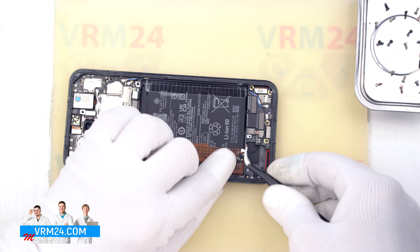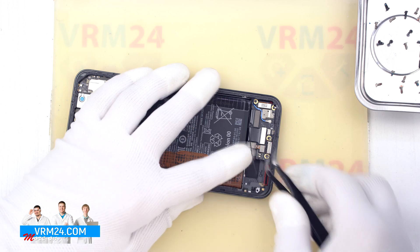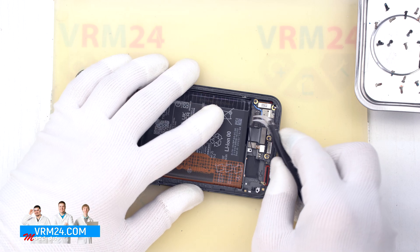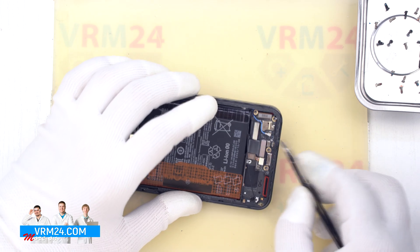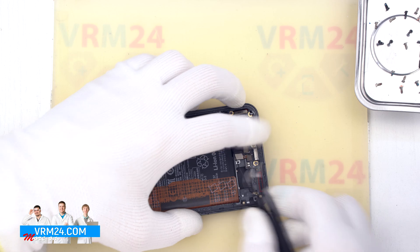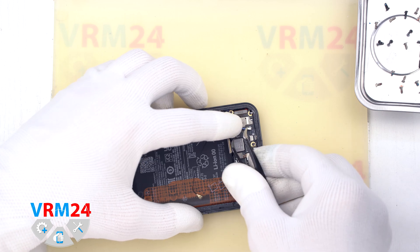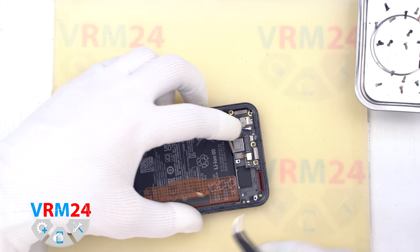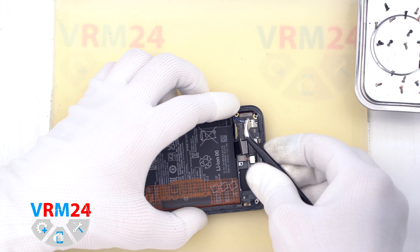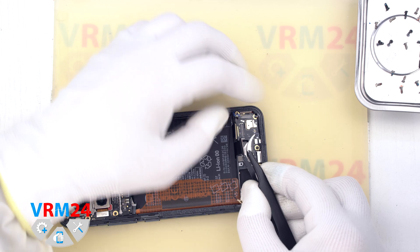We can carefully remove the small antenna board. Next, we need to disconnect the interboard cable connector, the fingerprint sensor connector, the coaxial cable connector, another interboard cable connector, and the display connector. Now we can detach the sub board, which is slightly recessed. We find the right place where we can hook and remove it — the sub board is held in place by plastic clips or hooks. We detach the board, make sure nothing is in the way, and carefully remove it.